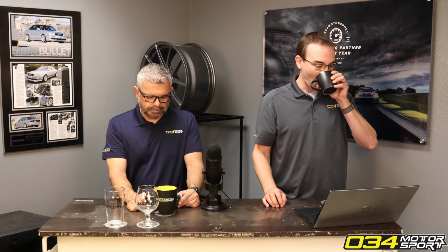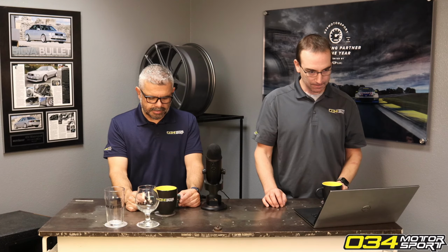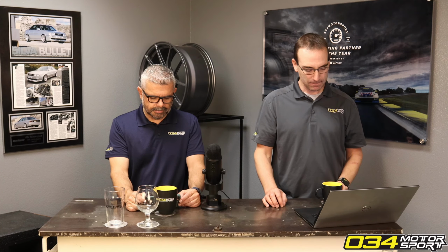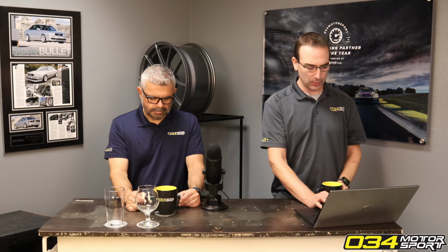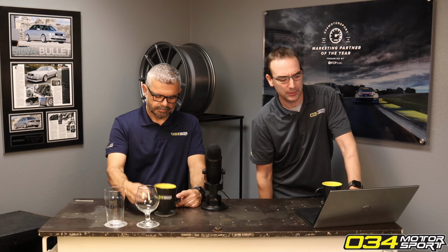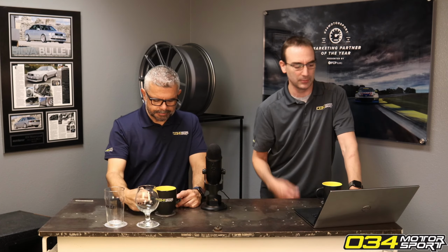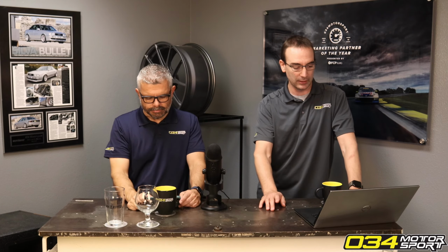I feel like the launch control on B9 Stage 1 E85 is less aggressive than Stage 1 93, and my 60-foot times are worse. Will you be releasing any updates? We actually are working on quite a bit of launch control updates. There's a lot coming. I don't know why it would be less aggressive on E85. The launch point changes a little bit with the transmission because of the torque outputs. But we are actually playing with that, and we'll have some adjustments done on both E85 and 93.